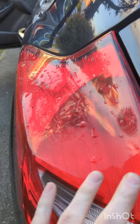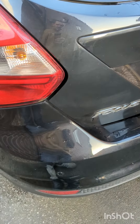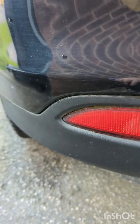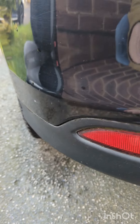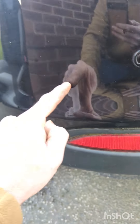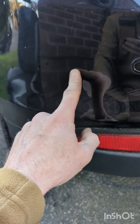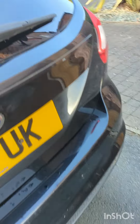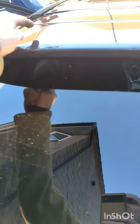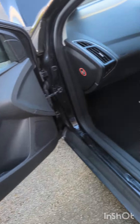You can see it's moving about so there's definitely water getting through there. The other common place — I've knocked the bungs out under here, there's two rubber bungs underneath. There's also somewhere I could take the bumper off, and there are two little vents either side, but they just need resealing with some sealant — it could be getting through there. There are also two seams on the inside of the roof where it could be getting in.